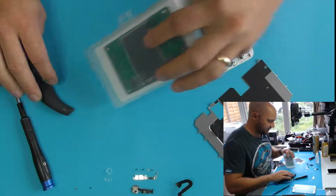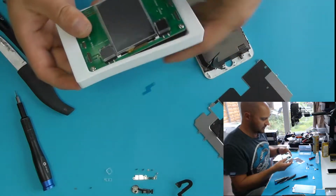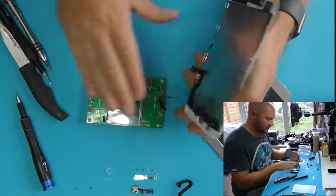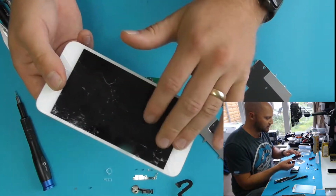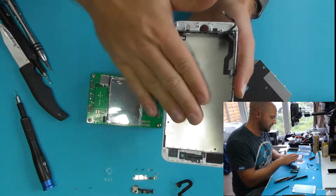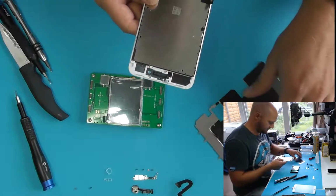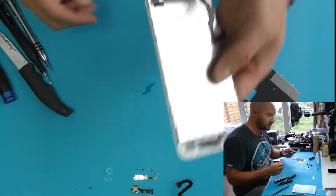China have very helpfully made a tool available that will read this serial number from this screen if you plug it onto the machine, and then write that serial number onto a replacement screen. So if, unlike this one, your screen was completely damaged, we could still take another original LCD and write the information from your screen onto the new screen, preserving all the features that you know and love in your phone. But we won't need that tool on this one, provided we don't break the LCD.